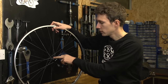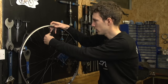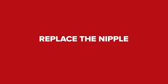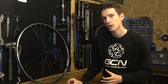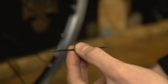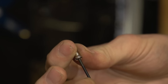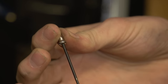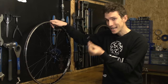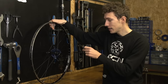In most three cross wheels, the spoke goes outside the first two spokes that it crosses, and then inside the third spoke. Next, if you've taken the nipple out, it's time to put it back in. This is a job that can be made a lot simpler if you have a spare spoke lying around, or a suitable length of your old broken spoke, because you thread it into the opposite end of the nipple to normal, several times, and then you have a handy poking device for threading it back through the rim — which is particularly useful on those deep section wheels, because you really don't want to lose that nipple inside the rim.